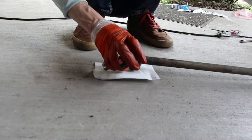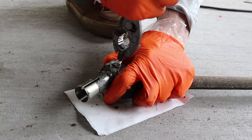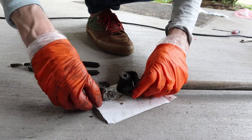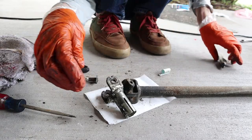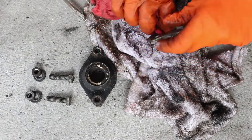Out of this entire project, that has been the most difficult part. I'd say the worst part of this entire thing is trying to get the boot onto the transmission, and these mosquitoes are getting worse by the second. The next thing I want to do is clean up the rear shift shaft, just in preparation for the new parts to come in. I'll also be replacing the U-joint at the center of the two shift bars, and like everything else in this shifter assembly, it has a top and bottom — I made sure to mark them. The rear bushing assembly came apart pretty easily and I just cleaned everything up with some degreaser.